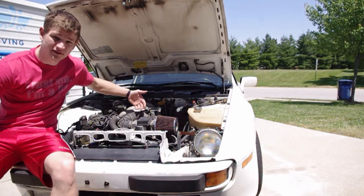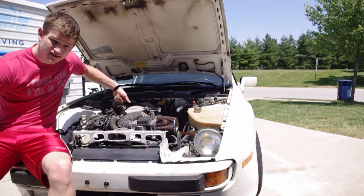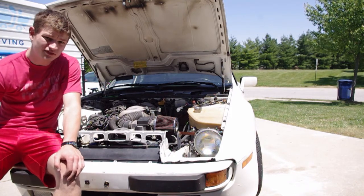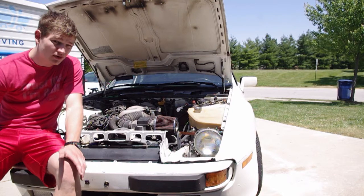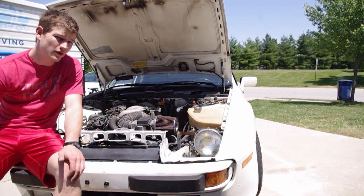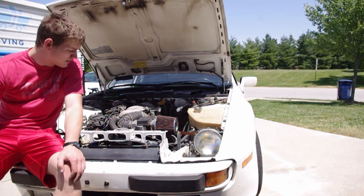After flushing the radiator system, I used this little bleeder valve here to make sure that when I refilled it with the actual antifreeze, I got all the air out of it. I sealed it down, making sure to use a new copper or aluminum washer, and then I ran the oil through it once for about 2 minutes, drained it out right away, changed the filter, and changed the oil. I think it's good to go. I took it for a spin, and it feels very powerful. I checked the oil again, and there's no cross mixing between the oil and the coolant, so I think we fixed the problem.